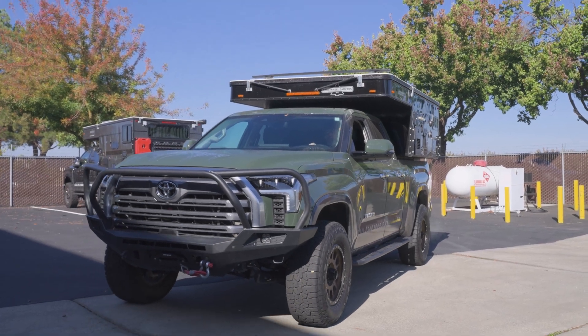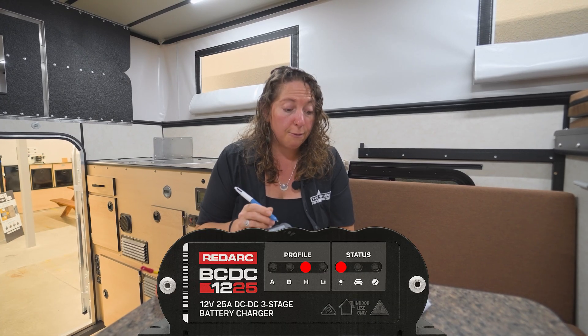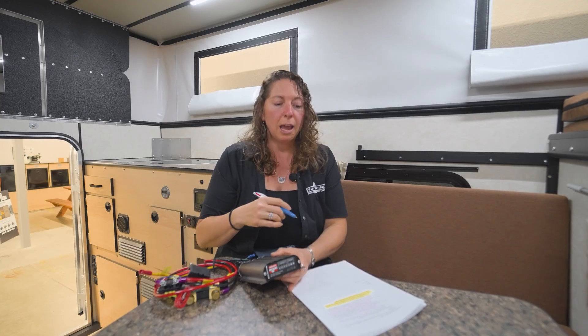The last power system check is going to be for your solar system. Again remember that if your battery is around 90% or more full, the DC-DC might not try to add a charge to the system to prevent unnecessary cycling. So if your battery is around 90% or below, first make sure that you're parked in full sun and your panel is getting maximum sun. Then come back inside and check the DC-DC — you want to see that this solar input light, the one with the sun symbol, is on. If it's not on, take a voltmeter outside and probe the rear SAE plug — the accessory solar plug on the back of the camper. At that point you want to see a reading of about 18 volts or above. If you don't see that, contact your dealer.